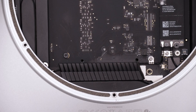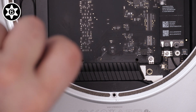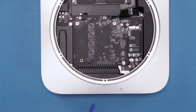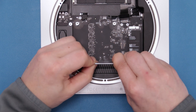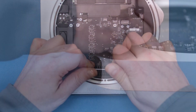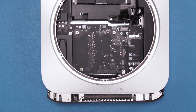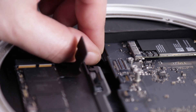Now we can work on removing the logic board itself. The first step is to remove the T6 screw near the heat sink that secures the logic board to the chassis. Once you've done that, insert the logic board removal tool into these two holes in the board until both sides are fully seated. Angle the tool towards the back of the Mini and the logic board will start to slide out. Continue pulling on the tool until the clips on the rear panel are clear of the edge of the case. You can then remove the tool. We now have room to disconnect the power cable from the logic board — simply slide it out of its socket.